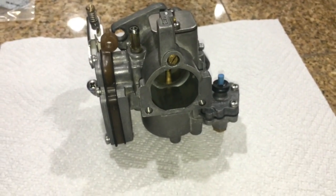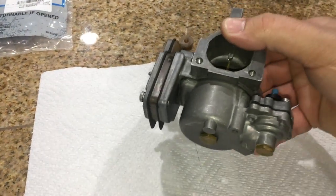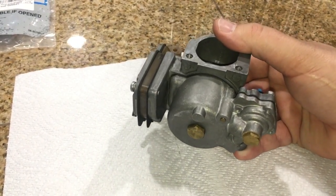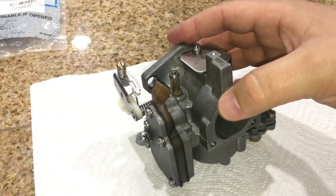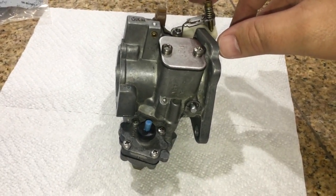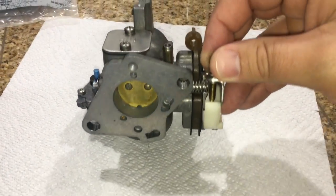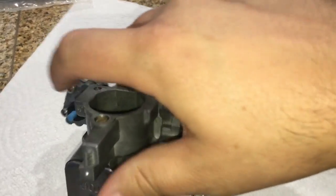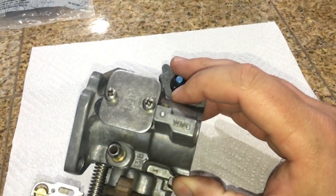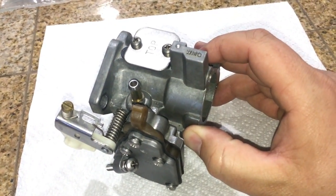We got this back in the house and I'm going to work on taking it apart. Make sure there's no fuel in it — you can drain by taking these two screws out at the bottom to drain any extra fuel. Keep in mind where all your different pins and gaskets are so you can put them back in the same place. This is the motor side. I believe this model is the WMC-53A — that's the model number for this carburetor.